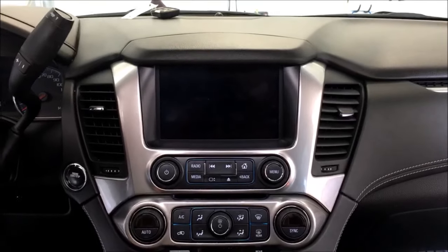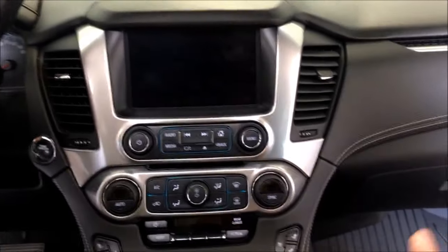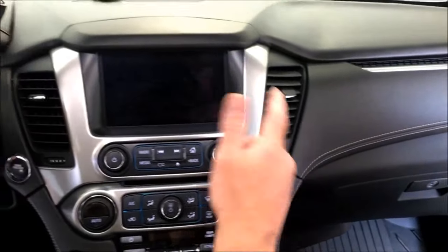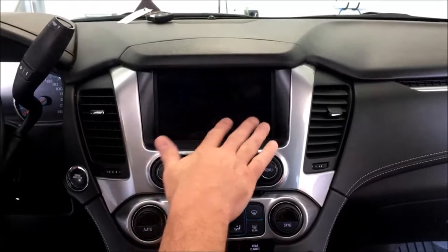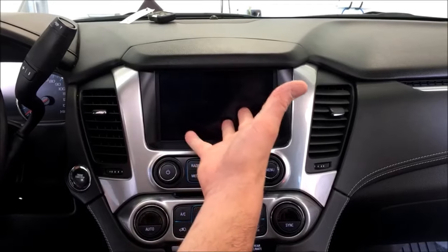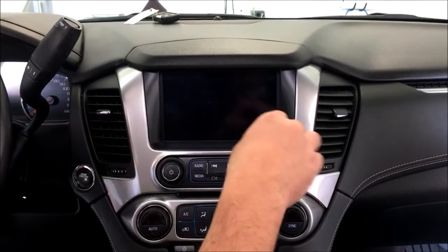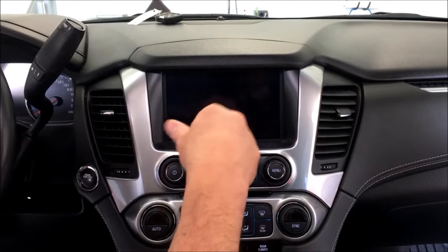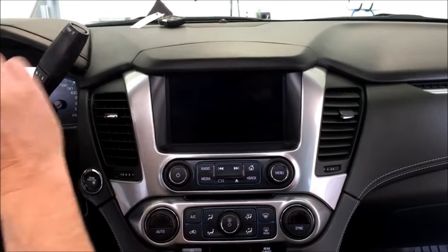But I'm going to start over here. We are going to have to get behind this glove box, guys. The screen does have to come out. There will be a new screen going in. The reason being, the electronics inside the screen itself has a different video chip, and you can't add just that chip to the existing screen. So the screen has to be replaced.